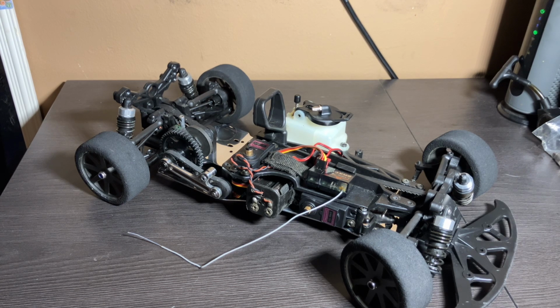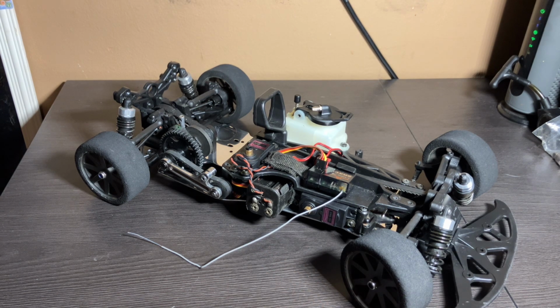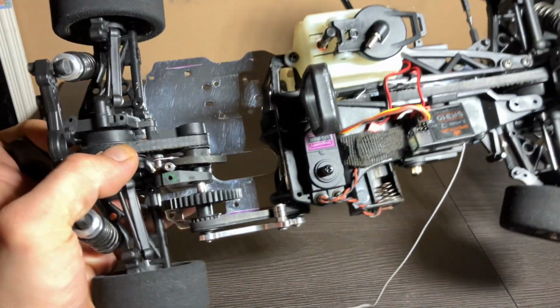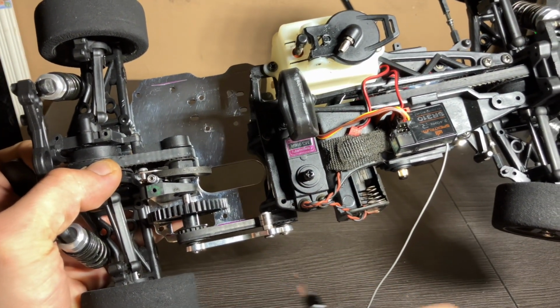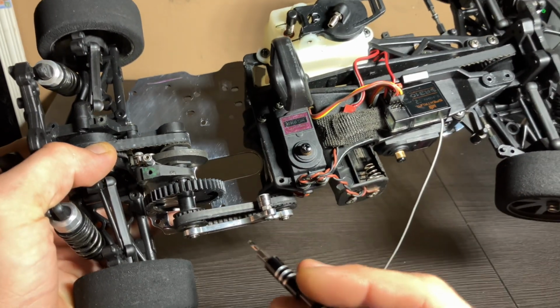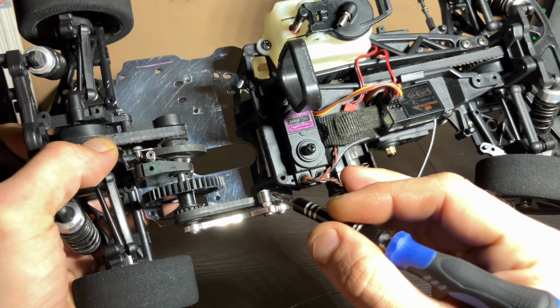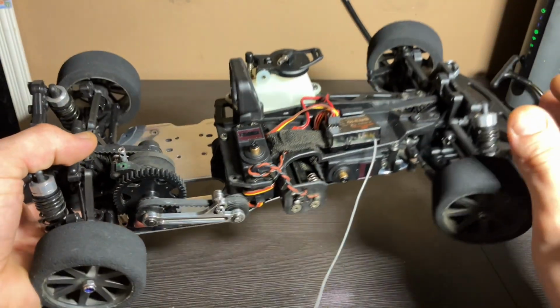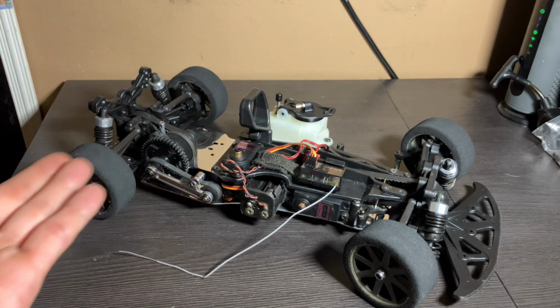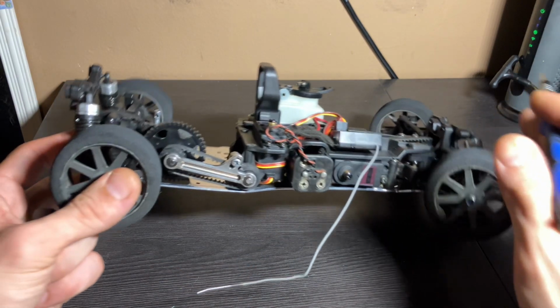But now that I'm taking apart the vehicle and putting it back together, I see that it was set improperly from the previous owner. I bought this middle tensioner and I set that improperly and I put a huge scar down the belt. You got to remember not to tighten these too much because of the bind that they cause, but also these are split bearings. These aren't just one solid bearing that rides on the belt. So you can potentially ruin your belt by over tightening that as well. So you remember, you don't need much on it.